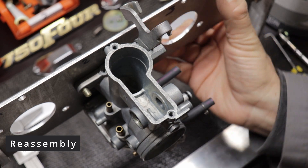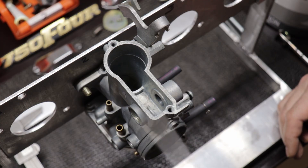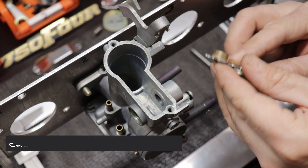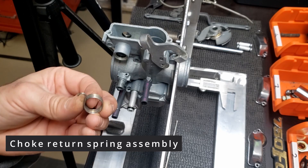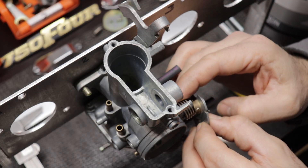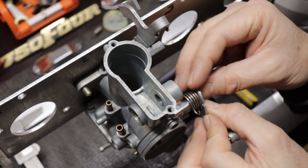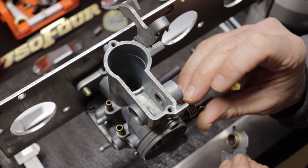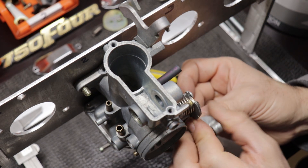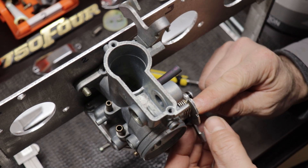Here we can see the simple fixture that I made — I'm calling it my docking plate. It's really just to help you hold everything still while you get all this stuff back together. I already have the seals in for the throttle linkage shaft and I've also attached the cable stay, the bracket that holds the push-pull cables for the throttle. The first bit you're gonna see me bolting on is just the lever for the choke spring assembly. Once I remembered where the inboard side of the spring clipped on, I managed to get the linkage back together — it actually has a little bit more tension on the spring going back farther.